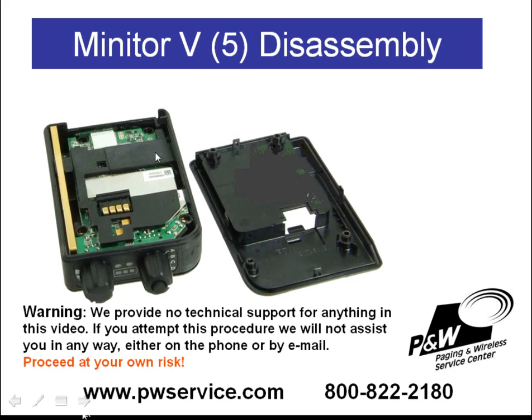This center one is not going to fall out, but the other one may fall out or it may be stuck to the old back housing. So you'll want to remove it and place it back into the pager — it only goes one way. It's fairly easy to figure out which way it goes, but you'll want to put that back in the pager if you're just going to change the back housing.